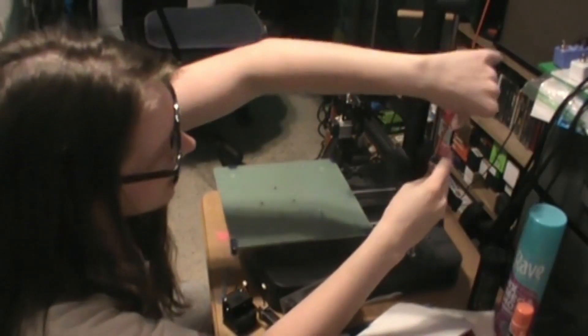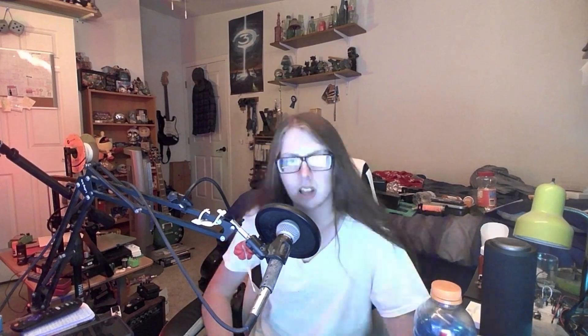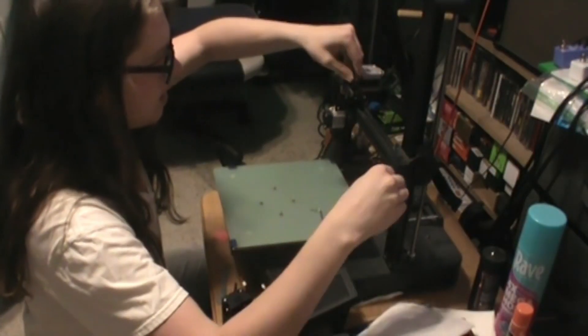Customer support recommended that the wobble could possibly be fixed by tightening the tension belt. I assumed it was the belt on the X-axis V extrusion. So I first tighten some pieces behind the belt tensioners, following another Creality support video showing things that can come loose. Then I moved to the actual belt tensioner, put it at max tightness, and it only minorly helps, so I loosen it up a bit to avoid over-tightening. I also talk about how annoying the head cover is during this maintenance.